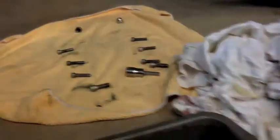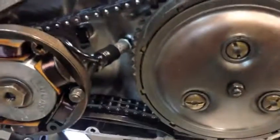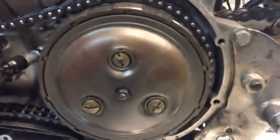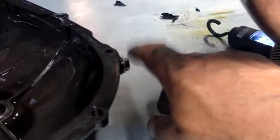It's off, alright. This is a 650 Triumph. So, you got all those over there. You need that to catch all the stuff that's in there. It's a wet clutch, not a dry clutch. Alright, so this is the filler. So refill it. Alright. You got another plug right here on the outside. That's to adjust your clutch. Alright. Then you have this, which is your drain plug.